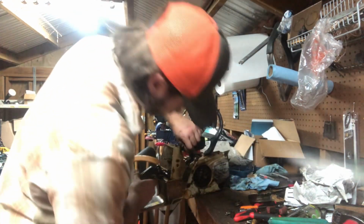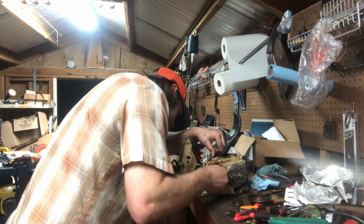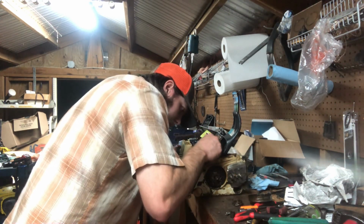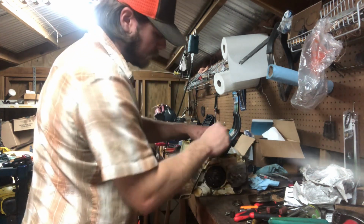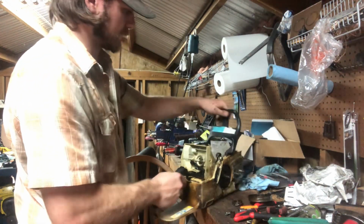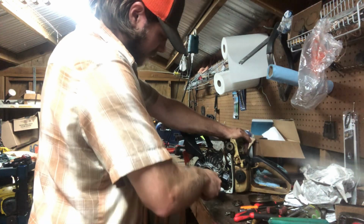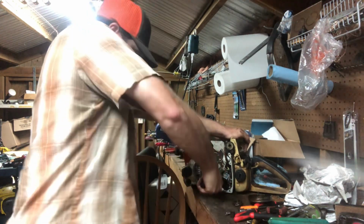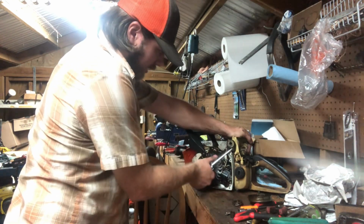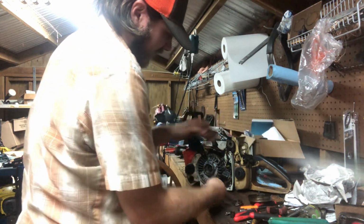I believe, I took the clutch off because the clutch was grabbing. Big end on the rod, it's good. It ain't got hardly any play in it. Let me pull this coil off. I think this coil is set too tight. I think it's actually dragging on it. Oh, my mercy, somebody had that tight. Somebody done tightened the fire out of this guy.